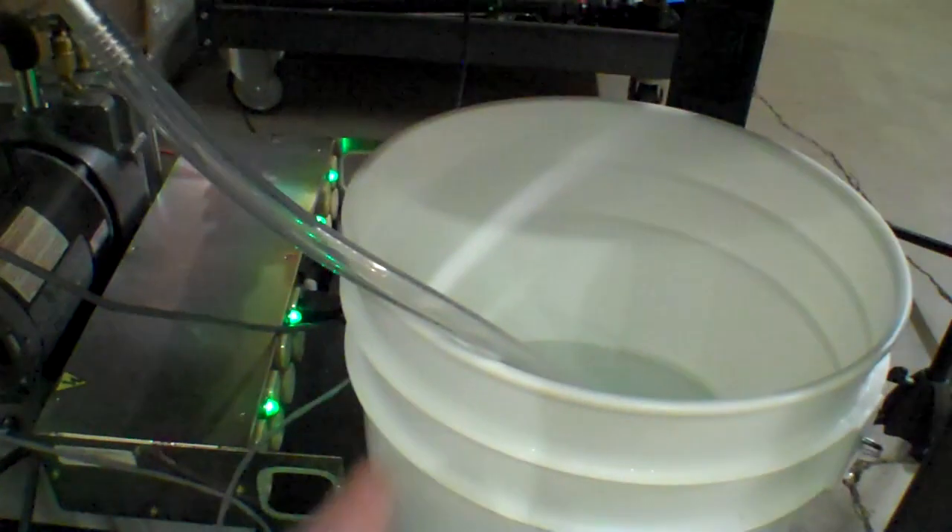We've installed a couple of these fittings — let me show you what it looks like. With two of them, you see that the hose remains straight. Of course, it's in the bucket of water right now. You can get something like this in plastic at any auto parts store, but it's going to be a Y-shape. You really need two of these installed to get enough airflow so that the vacuum can't pull the column of water up that pipe.